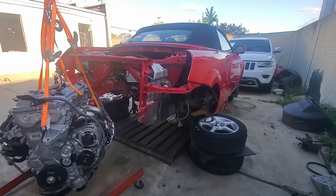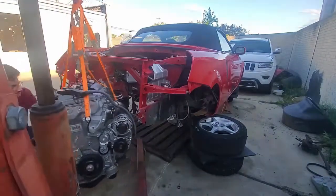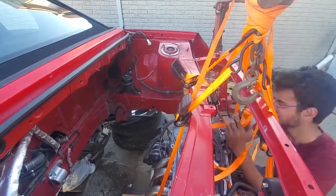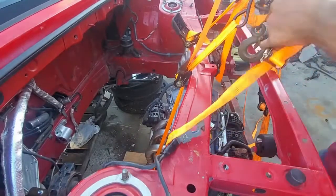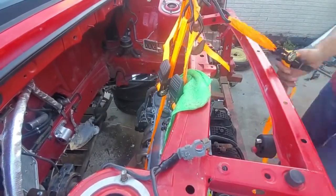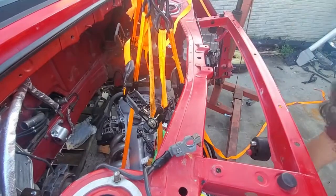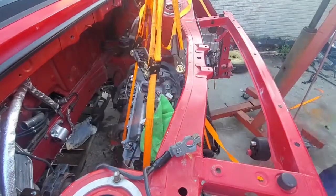The car is lifted as high as my jack stands can go. I have about 6 inches of ground clearance below the motor, which is enough for me to slide a pallet underneath for extra precaution. Because I didn't want to set my engine down and reattach the straps, I decided to undo one strap at a time and slowly work the engine towards the center. At the same time I'm reattaching the same straps from the middle of the engine bay. This method took longer but meant that the oil pan wasn't going to be accidentally dented if I rested the engine the wrong way.